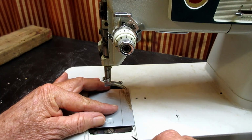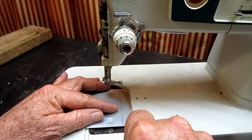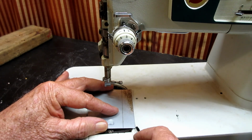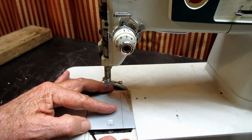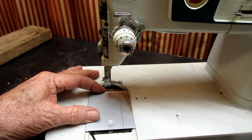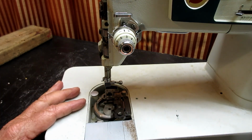You're going to get it up close to the spring, and then you're going to take a screwdriver. You don't need one this small, but it's my favorite. And you're just going to tilt up, get it under there, and lift up the end of that tip of the spring and slide this on it. Now don't go too far, because you still have to come over here and lift this side, and see how it's at an angle now, so I can get that side of the spring in. Then it seats on there, and you bring it forward, and when it goes back and the spring hits those crimped ends, it stops.